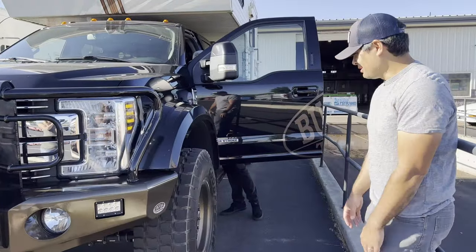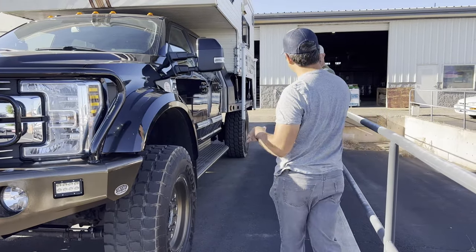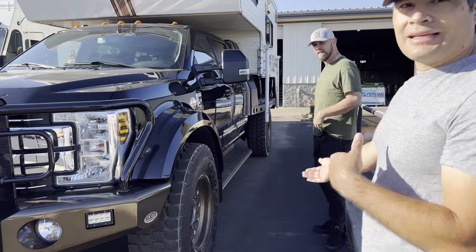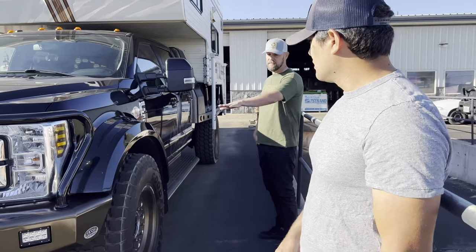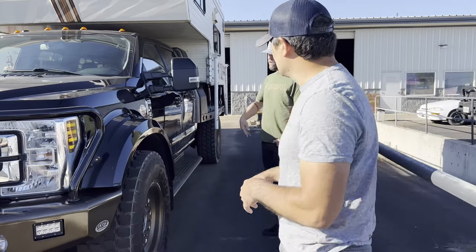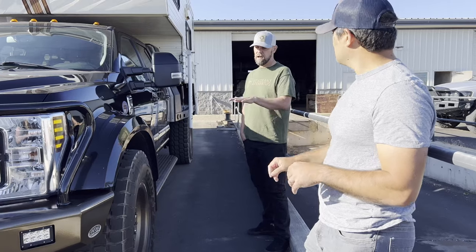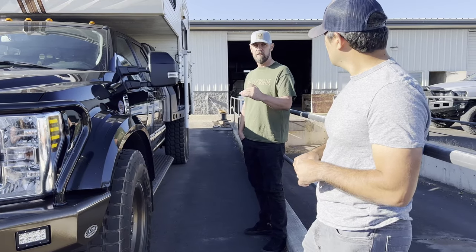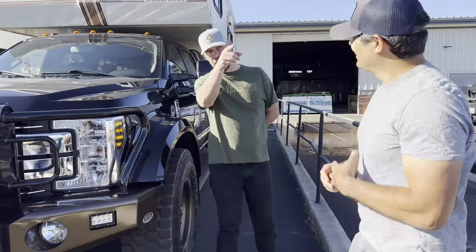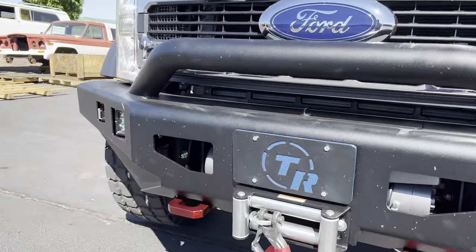Is it in ride height right now? Fully lifted — three inches above ride height. The back lowers first, then it lowers the front. It'll always raise the front first so you have full steering as quickly as possible, then it lowers the back and then the front. This lowered configuration is sitting on the bump stops. The benefit of being in this configuration is ingress and egress — getting in and out. If you want to put it in a garage, you can drive it in at low speed, up to about 10 miles an hour, after which it corrects itself. I personally love this look.